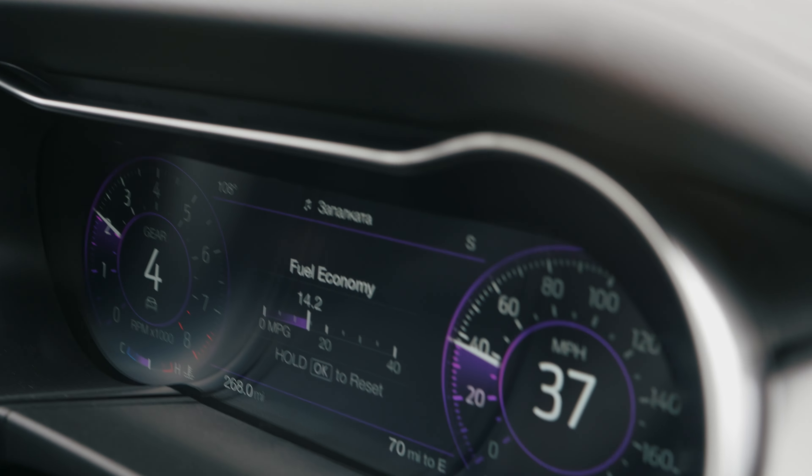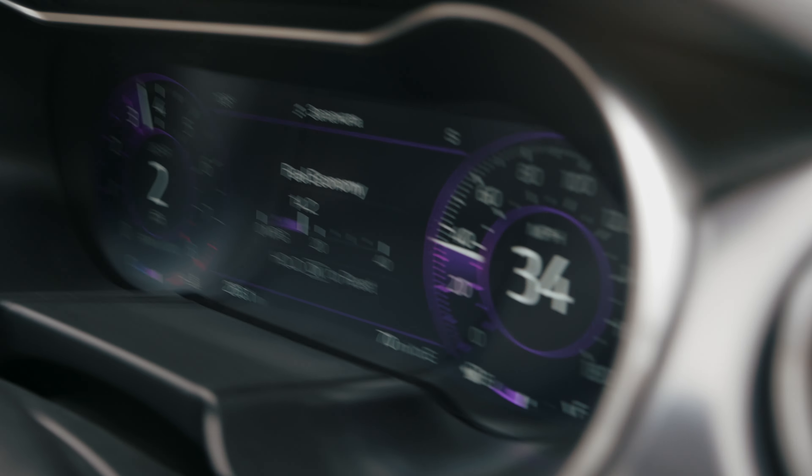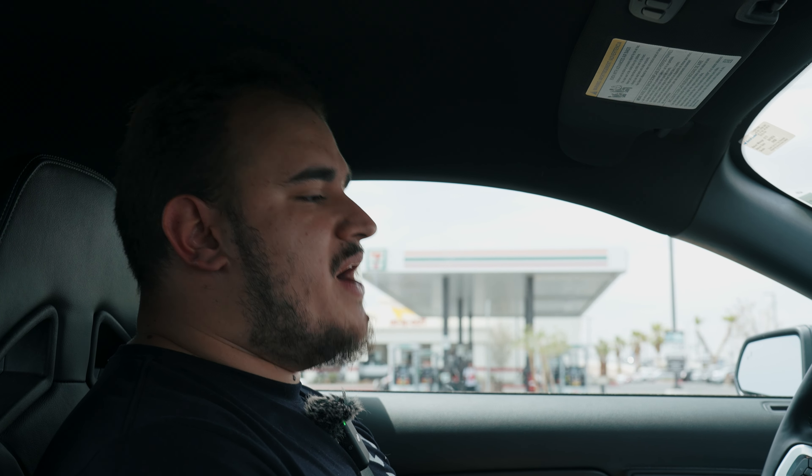With my old Porsche I was able to downshift and rev match perfectly because I learned the different rev positions of each gear. So we're coming to a light — that's fourth, that's second gear. The Mustang will do it itself, and it'll be quicker than me. Rev matching is super easy. For any of you guys that are looking to get better at stick shift driving, rev matching is great. Less wear on the clutch, less wear on the transmission, the engine, because you're not doing the whole jerky motion, and honestly less wear on yourself because you're not getting whiplash every time you go from fifth to third to pass somebody.